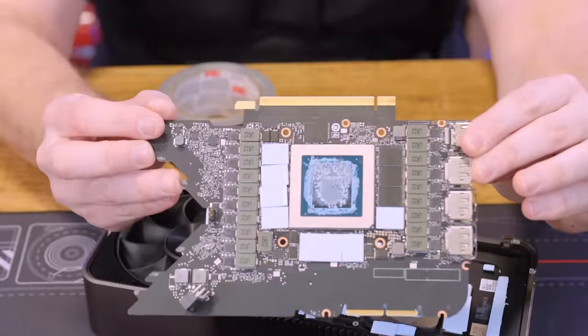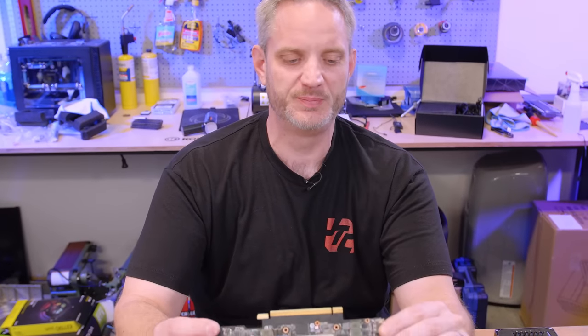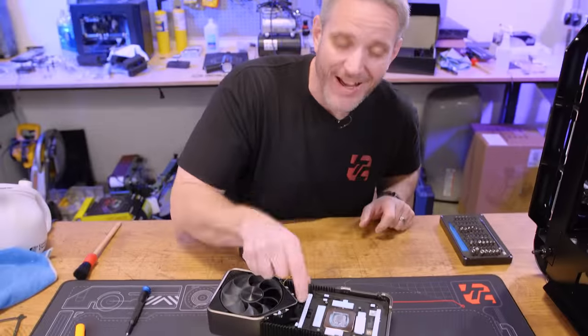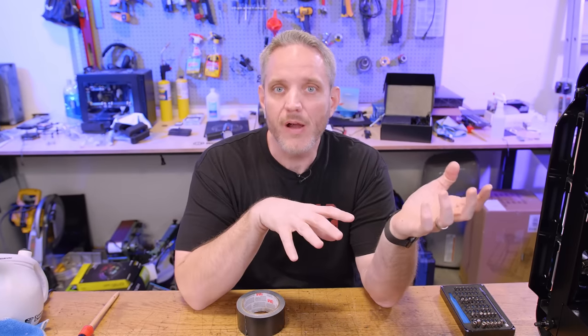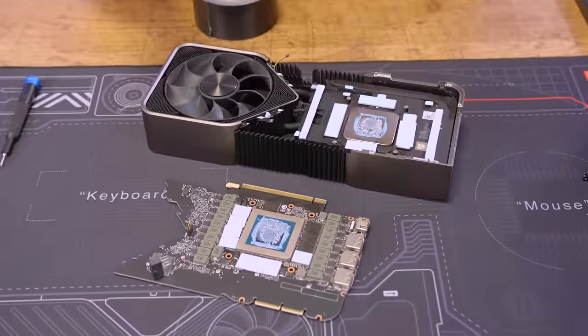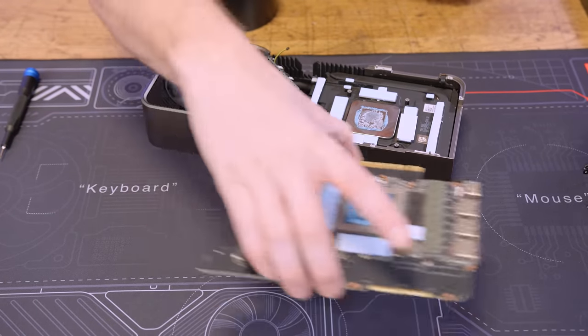Look at how much of that die is still shiny from where thermal paste never touched it — Jay the super professional guy. That whole part of the die was not covered. And here's the thing — that is the silicon. Any part of that that is not getting cooled can create hot spots which can create weird thermal throttling or fan increase. AMD reports the junction temperature as well as the edge temp, so you know the cool spot and the hottest spot of the card. Nvidia does not report that publicly — it's in there, you can dig for it in certain software, but you can't see it easily. I had been noticing that my 3090 sounded louder lately, which tells me it's probably because of that. I'm glad I did this now.